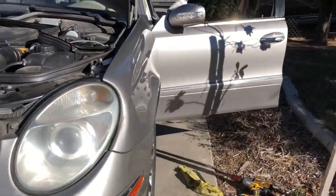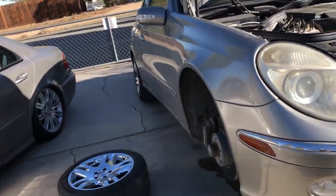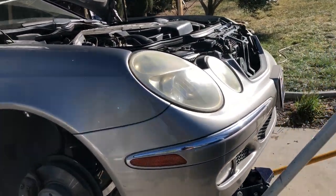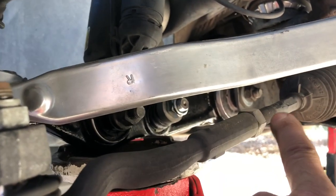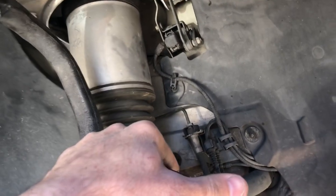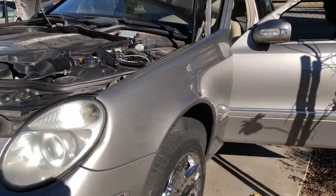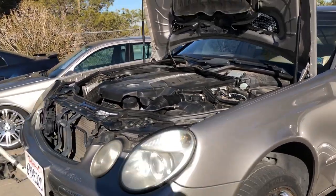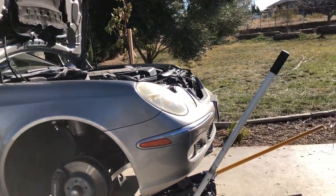You might find that your car will need an alignment, or at least the steering wheel set straight. Right now I'm in the process of centering the steering wheel. I drove it and the car seemed to be aligned fine, but the steering wheel was just off to one side. To set that up you have to fiddle with the tie rods — basically loosening this nut and pushing one out and the other in, or vice versa. There are separate videos on that topic.